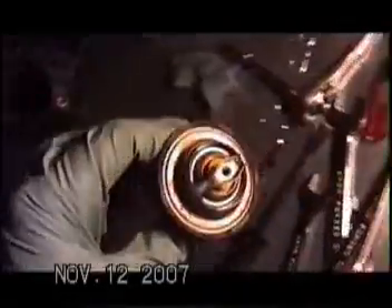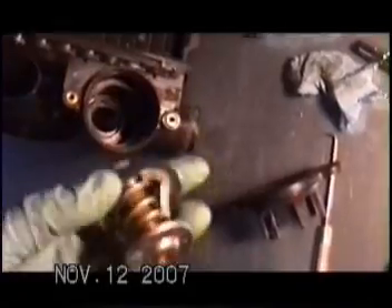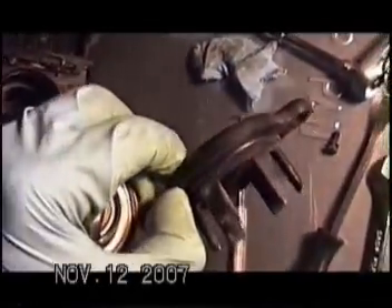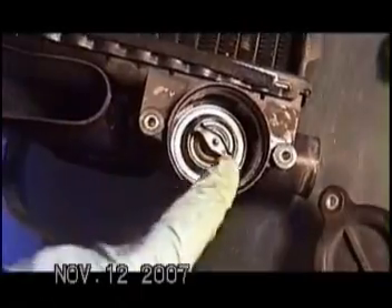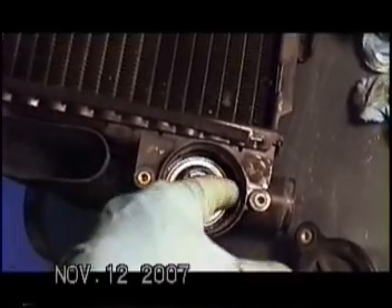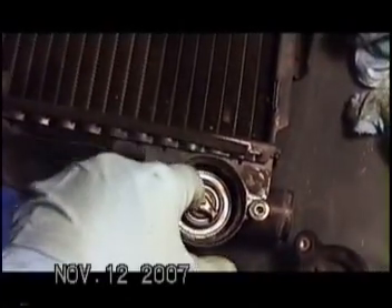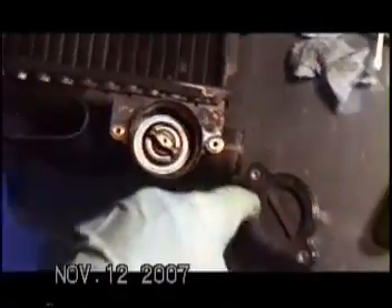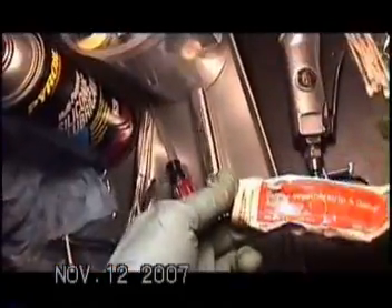Have no fear about reusing your thermostat. Mine was sticking badly because it had a lot of junk on it. I cleaned it up really well and now the bike runs amazingly — it takes only 20 to 30 seconds when the fan comes on before it shuts off, even when it's about 85 or 90 degrees. I put a little grease in the bore and applied 3M weatherstrip adhesive to the rubber O-ring, because otherwise the O-ring kept coming off when I put the thermostat in.